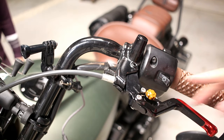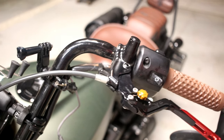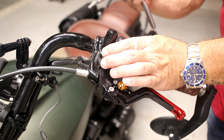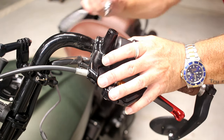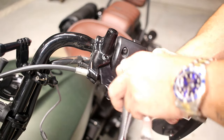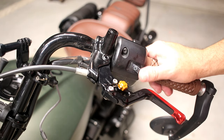At this point we should be able to release the slack on the clutch cable — there we go. That's the install. These have adjustments on the back side as well — if you loosen the allen wrench, you can make the levers shorter or longer depending on what you want. I'm going to try them short for now. I want to tighten this back on, hold the 10 millimeter down here, tighten that back on — and again these are adjustable. You can adjust how far out you want your pull on the clutch side and brake side.